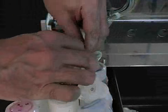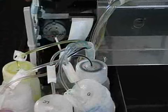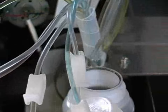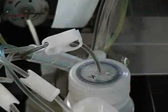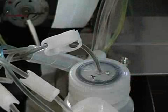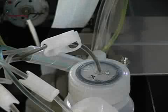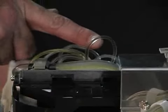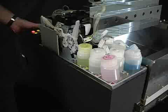Unclip the last line and press fill. Black can sometimes be a little more tricky and take more flushing than the rest of the colors. Once the black line looks clean and flushed, hold for a few more seconds and then you're done.